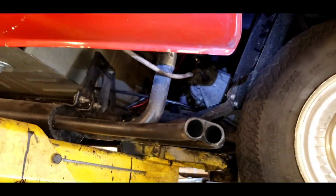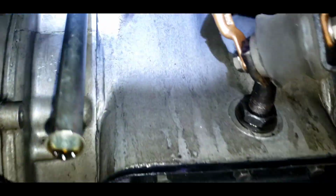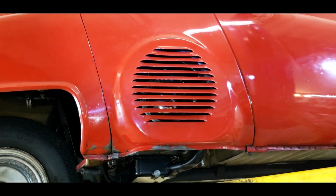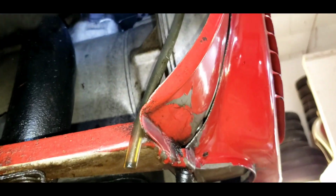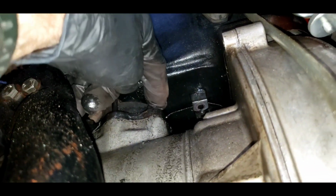The cylinder head popped off the top of the engine. What the heck? Oh man. Okay, well, stay tuned. Suspense is going to kill you. I haven't even had the engine cover off yet. The whole cylinder head right there, where it bolts down right here, is completely loose. Oh yeah, the nuts for the cylinder base loosened up.